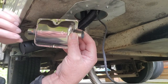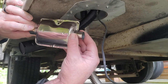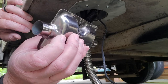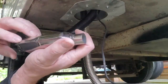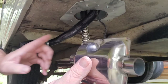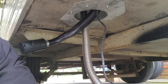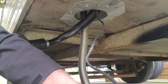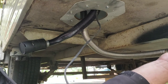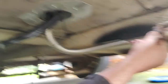Here's our muffler — you might recall from our first episode that it's actually proven to be the quieter muffler even though it is a straight-through design. It looks to be some glass packing in there. There's this little drain hole at the bottom here — it's important to keep that at the bottom because any condensation that could potentially build up in here, you want to allow it to drain away. You do not want condensation sitting in the pipe with any low spots in it. I want to dead-clamp this.